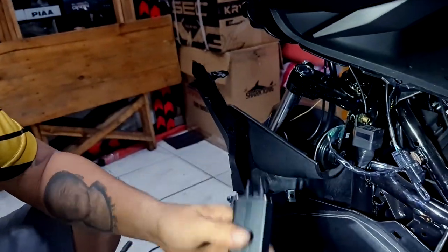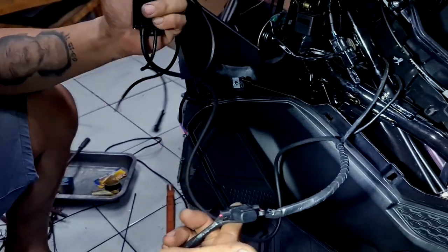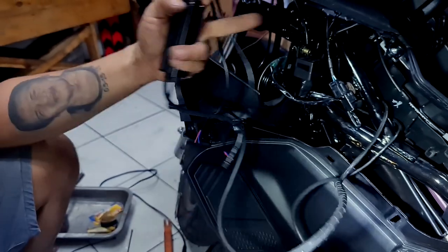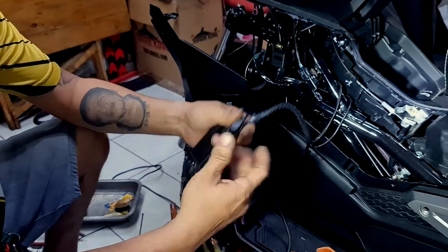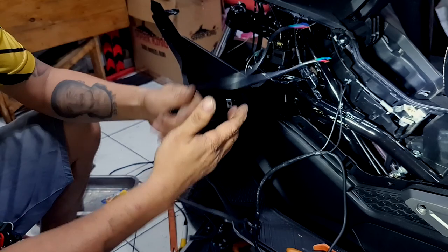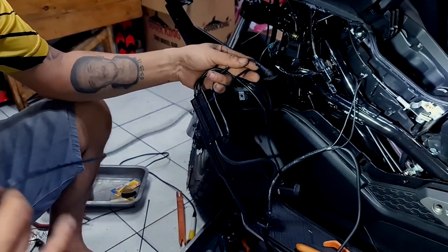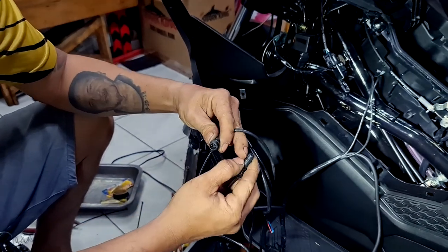The Atom is connected directly to the battery. It has a ready fuse of 10 amperes. Once done, it will be plug-and-play connected to the battery — positive and negative. The Atom switch is original and comes in the Atom package. It features high beam, low beam, and passing light. There is also a special feature where an additional harness from Atom connects to the system, which is what makes the Atom special and justifies its price.